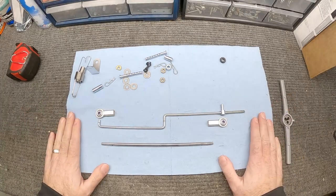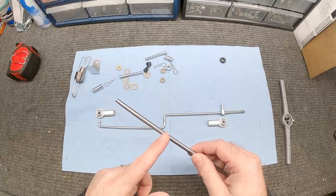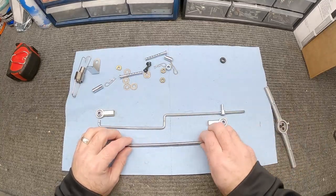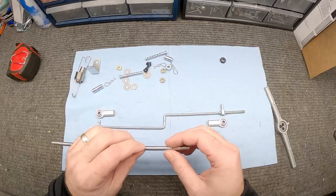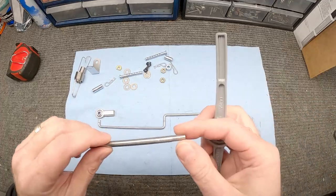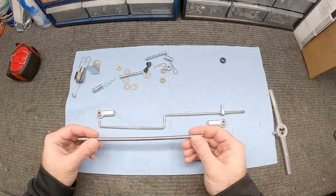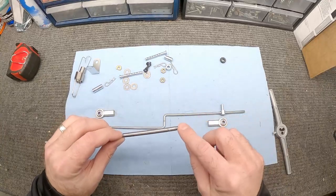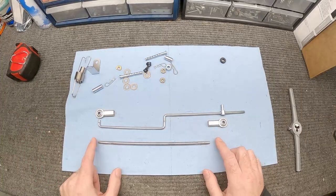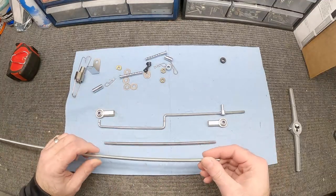I know what you're thinking — not only am I doing it the hard way, I'm doing it wrong. Most of you know that quarter-inch material is not the right diameter for running a die over it — it actually needs to be something like 0.22 or 0.23 inches. That's why I was sanding it down, trying to reduce the diameter on the ends to make the die run smoother. I kept going back and forth between the vise and sanding, but I couldn't easily get the material to the right diameter, so we're going to skip this and go straight to what I should have done to begin with.